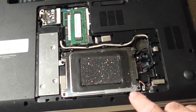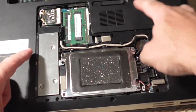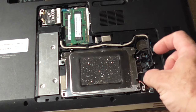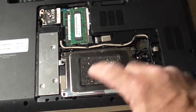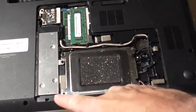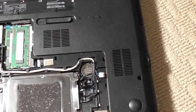Underneath there's some braided grounding material. That's how you remove the hard drive on the Pavilion DV6, DV7, maybe even DV5. You pop the lever, open it up, carefully remove it, and remove the four screws. Once you pull out the drive, be really careful — these are very thin wires. Some have a cable connector, others snap right into a built-in connector on the motherboard.